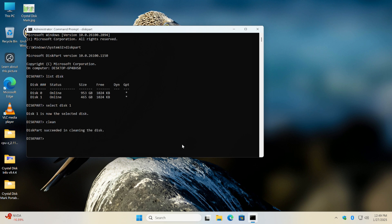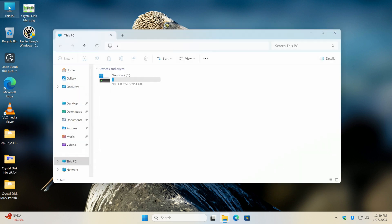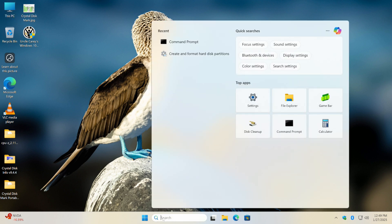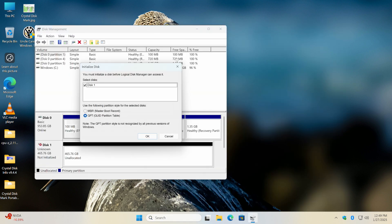Done — it's that fast. Type 'exit' twice and the D drive is completely gone. It's back to exactly how it was when it was brand new out of the box. Now type 'disk management' to reformat it. It immediately recognizes it as a drive with no partition or format. This is also a great simple way to eliminate multiple partitions without partitioning software or a paid third-party utility.